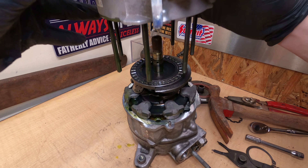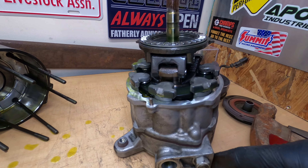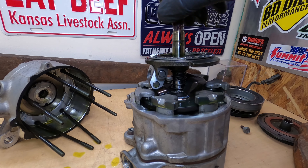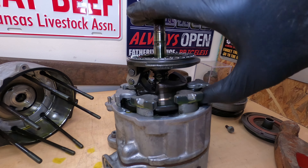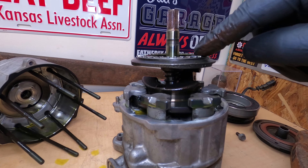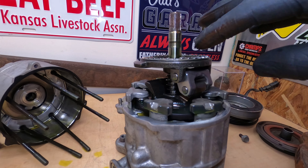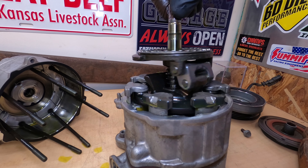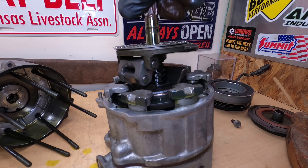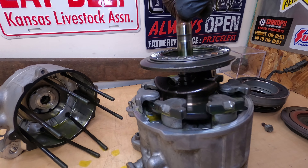There's the inside of the compressor — this is the inside of an AC compressor out of a 2014 Chevy pickup with the front case removed. The swash plate is adjustable by the solenoid on the back, and as it turns it moves each one of these individual pistons up and down. The bearing on top is the thrust bearing because as it's pushing the piston back down under fluid pressure, it pushes the shaft up, so the housing case rides on that bearing to keep it from pushing out the front. Let's keep taking it apart and see if we can find a failure point.